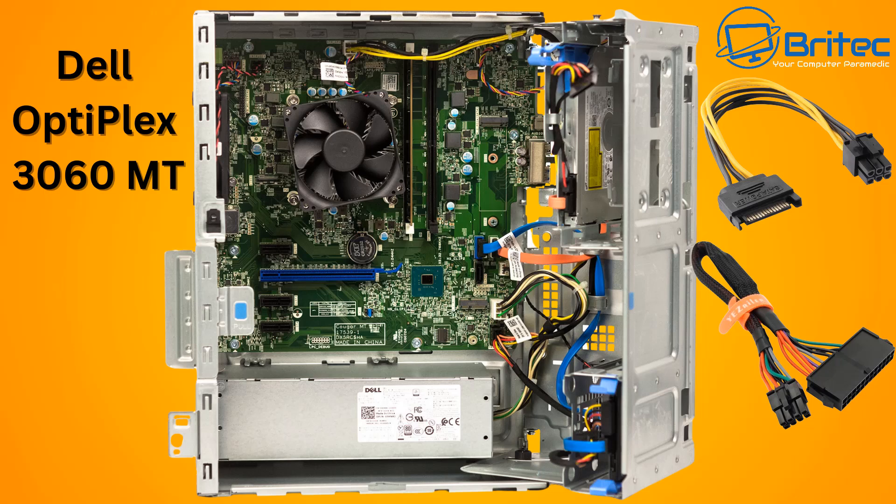There simply isn't enough power to use that SATA-to-PCIe method, and it will be a fire hazard or cause constant crashing because there's not enough power being delivered to the graphics card. Either way, it could end up blowing and taking all your components with it. That method is not good enough. There are also proprietary parts in the power supply — you would need adapter cables for that.